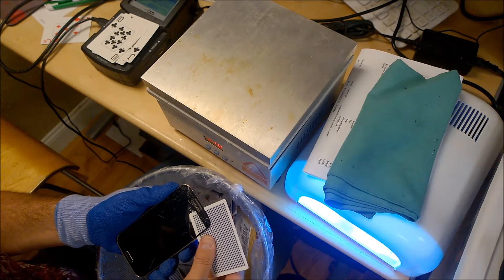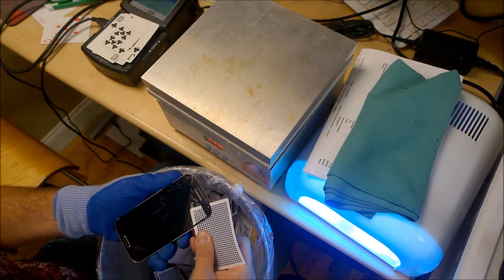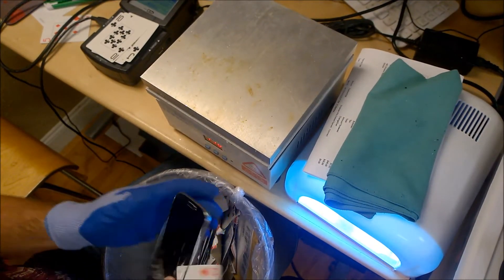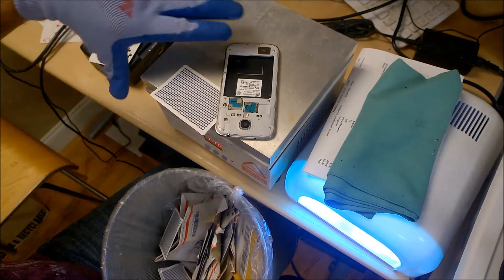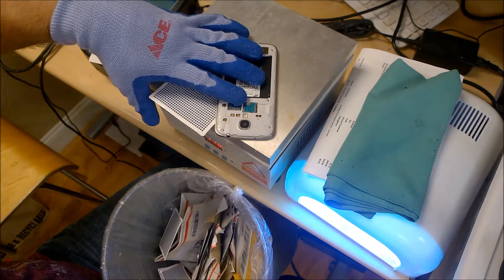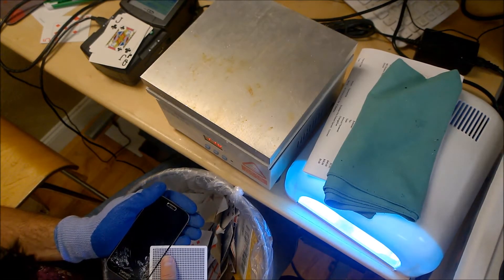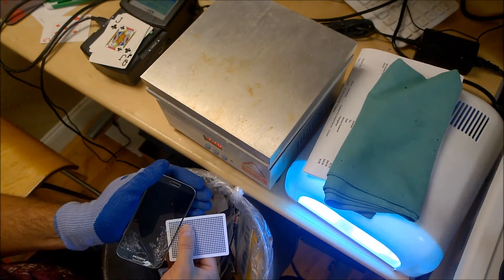What we're going to do here is very slowly work through this, and I will speed this up at some points because it's a lengthy process. This whole repair probably took a good hour or so. You can see right now he's going between the glass and the digitizer, maintaining a constant temperature. This is something that you learn with experience. After you experiment a little bit, find out how your heating plate works — what's too hot, what's too cool — and make sure you get it regulated properly. Then you can very gently and carefully work between the glass and the digitizer.